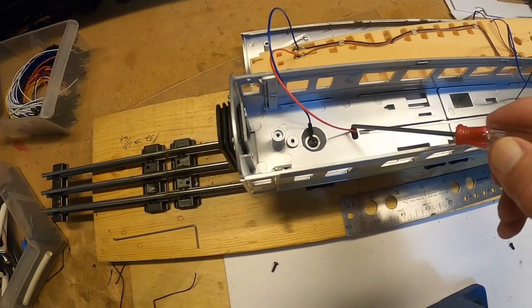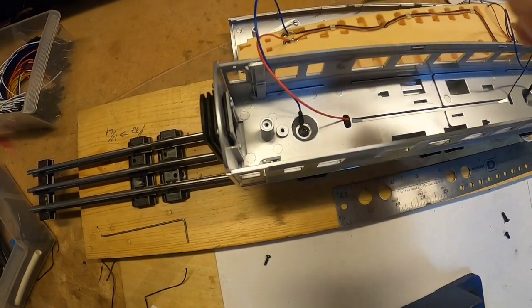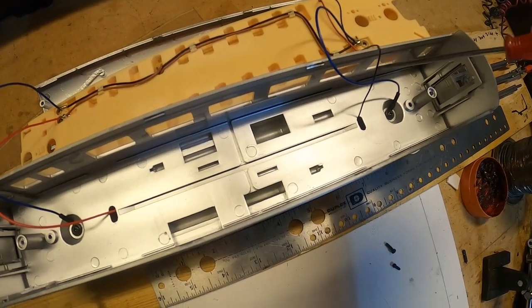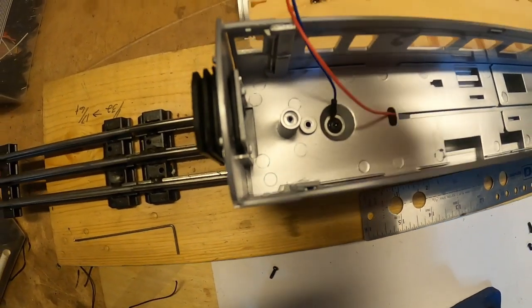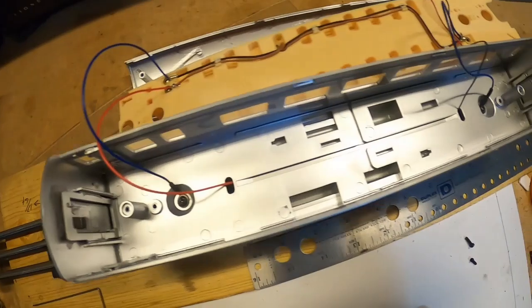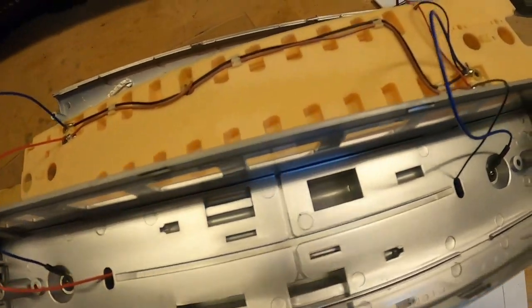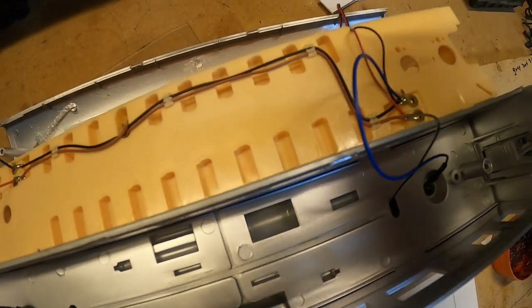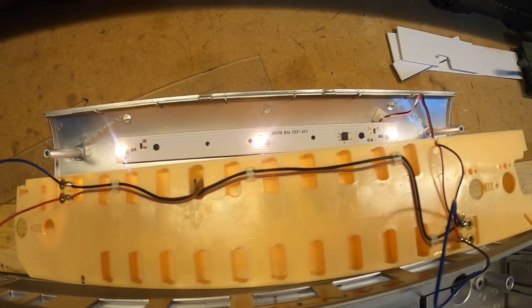I've got a new positive wire that's a much heavier gauge coming from the truck up to the positive side. This brown wire is positive, goes all the way up to there — though I left this weak wire which is probably going to break. From the ground post on the truck, I've got a heavy gauge wire soldered to the board over here — that's actually the interior board. Did the same thing over here, and it's to the black wire, which is the ground side. Then these wires go up to the... I'm going to turn power on — voila, we got light.